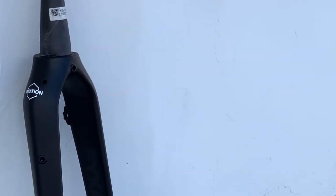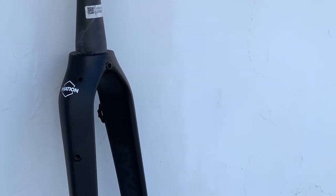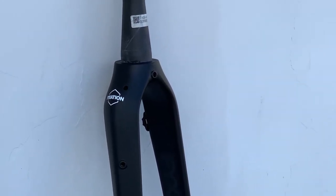I did throw in a 50C which didn't fit at all, and this is where I have the one problem with this fork based on its design. Aesthetically it looks great, but I wish in the fork crown they had rounded off where the tire sits, which would give a little more shoulder clearance — especially for 700C wheels. For 650s it still sits low enough even at 2.2 that this isn't an issue. But if you're creeping up to the 700 by 42 or 45 size, especially with a wider rim, the fork crown angle is going to pull your tire out slightly and that's where you'll likely get rubbing.